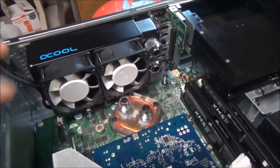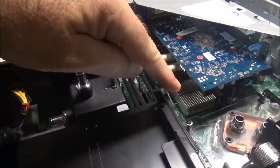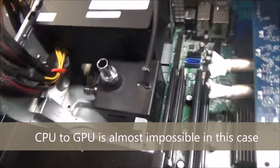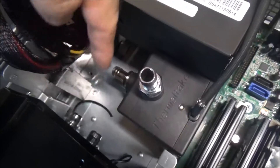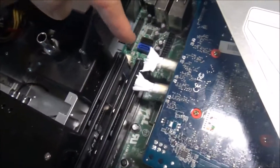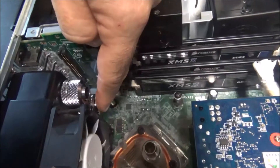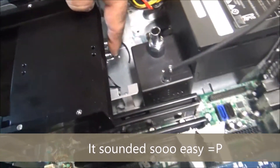In the mini tower 780 I had the pump going to the CPU first and then to the GPU, but in this one it's going to be a much cleaner run if I go from the pump to the GPU first. These two ports line up almost perfectly, so I could just get a 90-degree fitting right here or do a little bend. Basically it'll pull from the reservoir pump, go to the GPU, pump out here, then I'll bring it along to the CPU, and the CPU will come up to the bottom of the radiator.